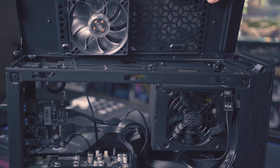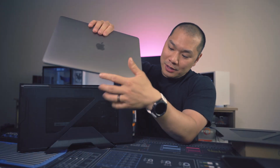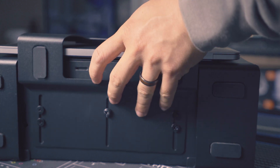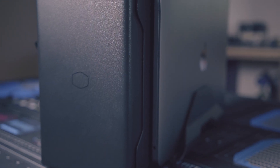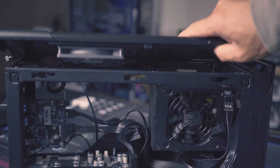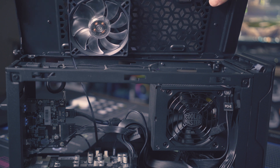You could mount one fan next to it, and there's an additional fan header on the PCB. The last feature I'll cover is the laptop stand or holder, which is a rather unique feature for eGPU enclosures. You can adjust the position of the clip to accommodate your laptop, and when properly configured, your laptop can just slot right next to the enclosure. I'll note that when the GPU is at load, there is some heat that vents out that side, and since your GPU is taking in air from this side and pushing air to either the top or the side, having your laptop there will slightly impede the airflow and the box will warm up a little.